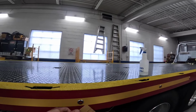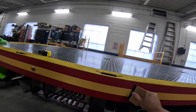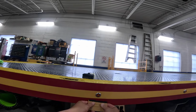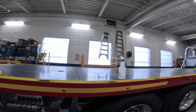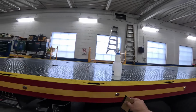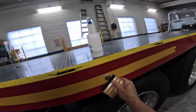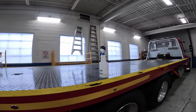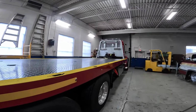And it's working out actually really good. You can see these trim rings move a little bit, and we just end up with a tiny little seam right there. No harm, no foul. It's minimal because it's above the light, and there's only a seam every fourth light. Sometimes you just gotta do stuff that you wouldn't normally do. Like I said, normally I'd pull these lights, but literally these stainless trim rings and the way the wiring's tucked, it just doesn't make sense.